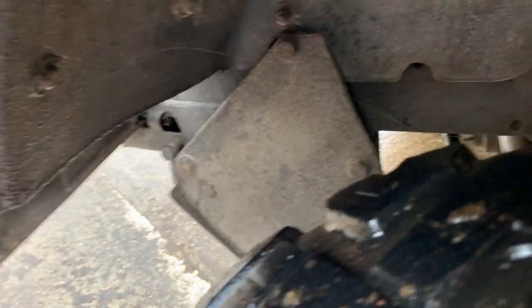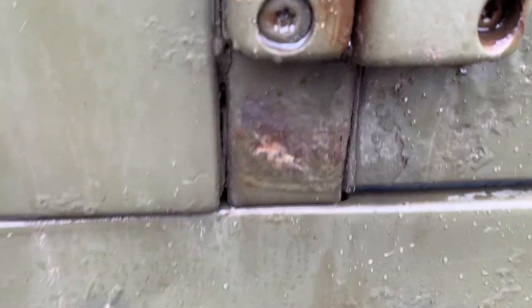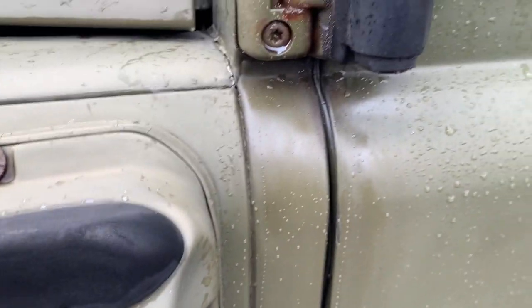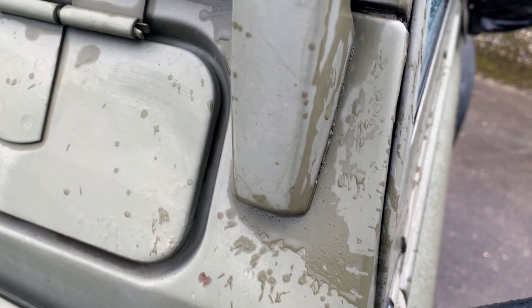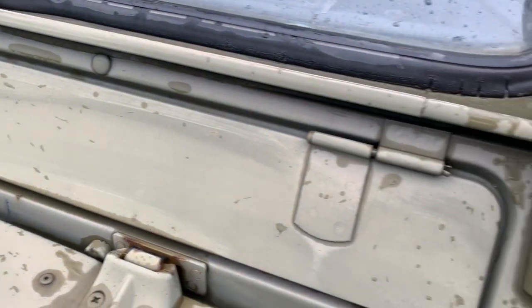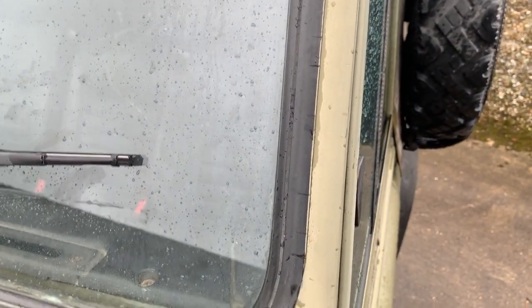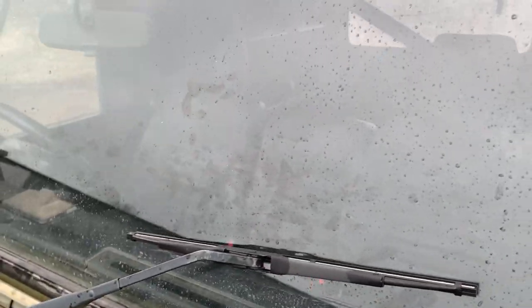Let's see if we can see anything under here for chassis condition — that's your front outrigger. Looking at the B-post, it's bubbling just slightly below the hinge and there's a bit of electrolytic reaction on the door skin there, but up the A-post looks good. The scuttle corner on the near side looks fine, just apart from the water staining. The screen rubber has obviously seen better days — probably the original — and the screen looks to be in good shape.